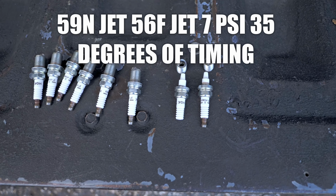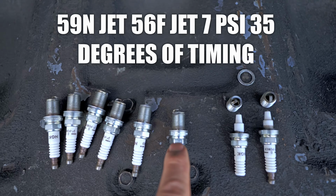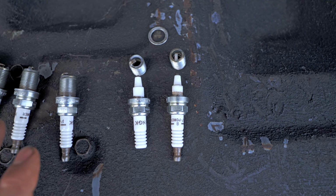All right, so down here are the plugs from the past. I'll go ahead and cut the rest of this off, but one thing I've noticed on E85, you have to be super fat to see that fuel ring on these guys. I was way down in the 11s. Some people call that lean, some people call that not enough. I am not sure. I do know a lot of guys who are spraying a bunch of nitrous. They run it really fat on the E85. I do have my theories that I'll talk about in a second.